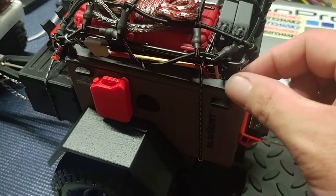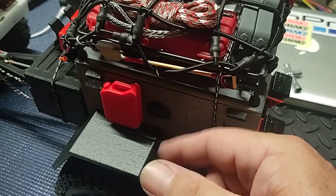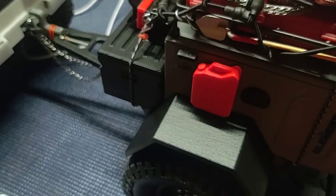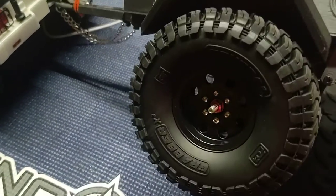The top comes off the trailer — this section here pops off and it's hollow, so you can actually access the inside. It's pretty cool because it's got the fenders, and if you look under here you can see the leaf springs. There are actually I think like five or six sets of leaf springs that are all different thicknesses, giving you different suspension settings and different ride heights.